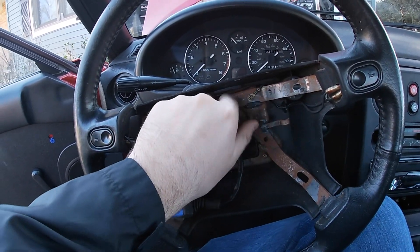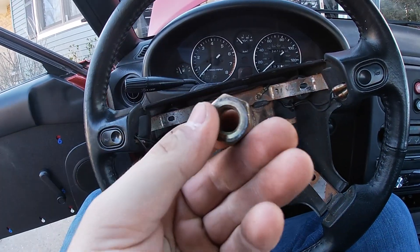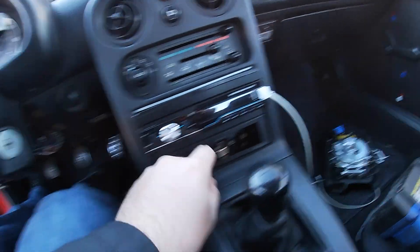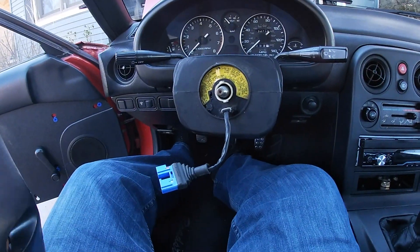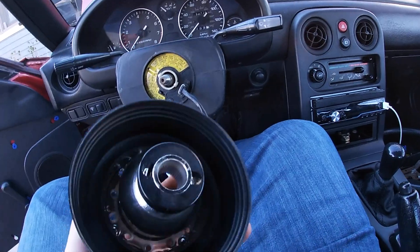You're going to take this bolt off — it's going to take me a second. Make sure you keep it on while you pull so you don't hurt yourself. Make sure you keep that bolt — you're going to reuse that. The steering wheel should just literally lift off now. Perfect. All right, we're in here now, got the hub.